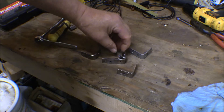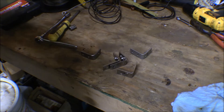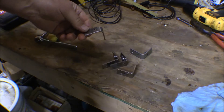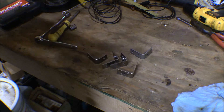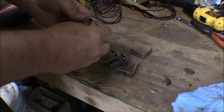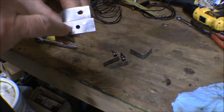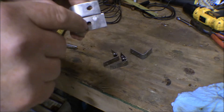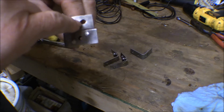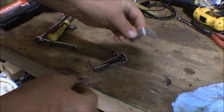I thought about putting new nut plates on them. These have the fixed style nut plates, they've been on there a while but they still work. The floating nut plates are a little bit easier to use — easier to get the screws lined up — but again, they're functional so there's no practical reason to change them. At one time, not long after I bought the airplane, they did find a cracked bracket during a 100-hour annual inspection. I had the mechanic make a new one. That one has been functional, but I didn't really like it. This hole where the cowling mounts is quite a bit off from this one — it's been rubbing and has elongated that hole. There's also no nut plate on that one, so I did go ahead and make a new one.